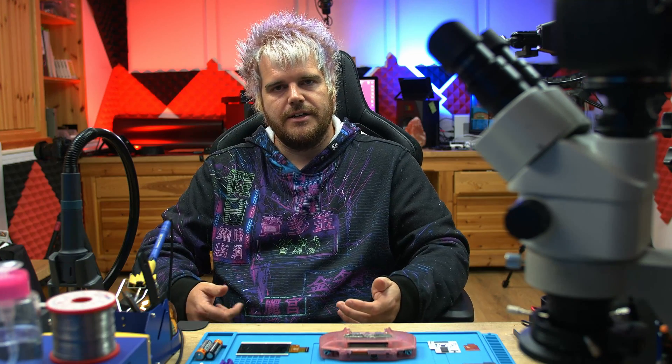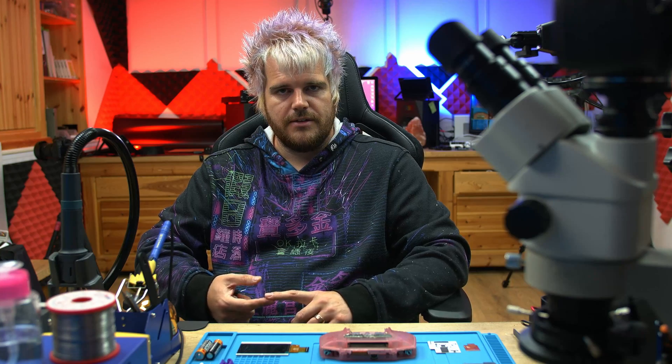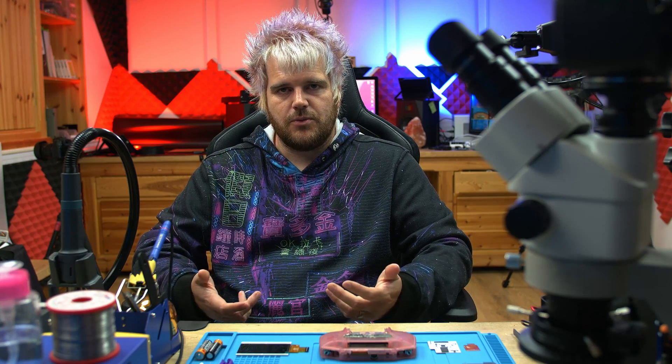I've made the clean screen for the Game Boy Advance, but this time with a heavy focus on using the original shell, the original screen, no cuts, no soldering — zero work whatsoever except a screwdriver to open the console up. You can obviously install these in our shells and install new glass lenses, which will be the original size as well. You don't need the IPS size windows anymore, and you can add a ribbon cable or wires to bring an on-screen menu up and do much more.